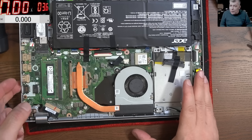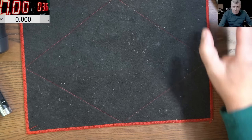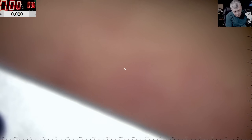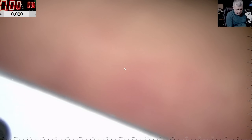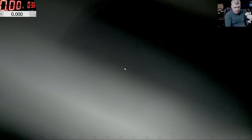The question is: can we fix something like that? I have no idea, but let's have a look inside the charging port with the microscope. I believe everyone can see the problem - the ground is touching the middle pin, you can see it. There are a lot of dodgy ways to fix this kind of problem but I prefer to just order another port. The fault is clear.